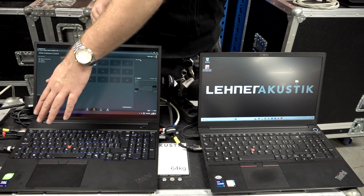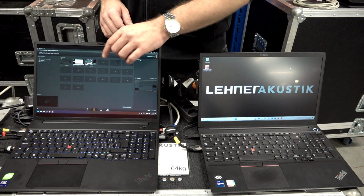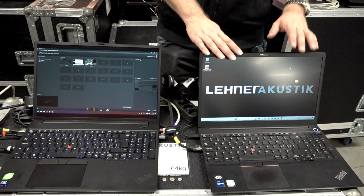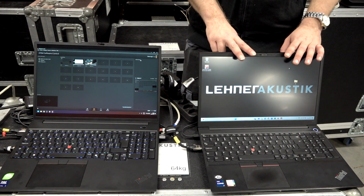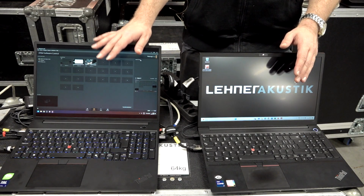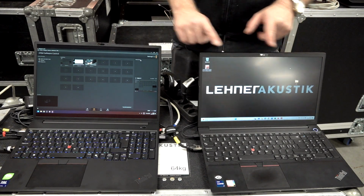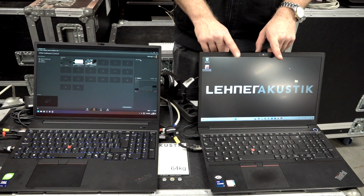But keep in mind, if you're using something like WebEx, you have to ensure that the driver used for audio on WebEx is the device that you are using. This does not only apply to the one laptop, but for both. So you'll need 2 audio adapters, one for this one and one for the other one. You have to have 2 laptops if you're running presentations to make smooth transitions from one to the other using the Blackmagic.